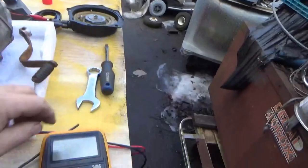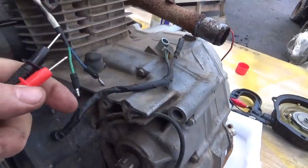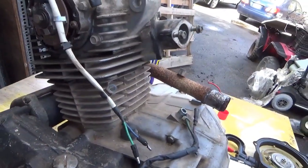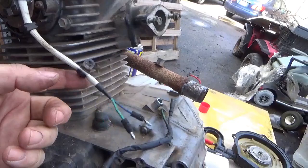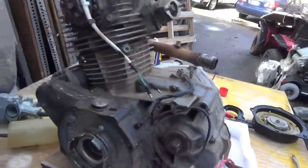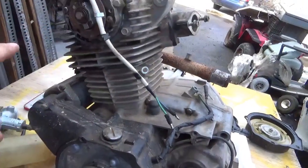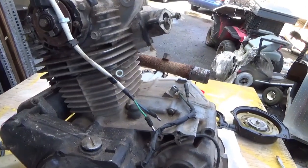One other thing to test: get your meter out and do a quick check of the pulse generator. This one is out of a parts box that was floating around, and I made sure the resistance was about 35 to 40 ohms. The really good ones are 28 to 29 ohms, but 35 to 40 ohms works. There's nothing worse than trying to get an engine started with a dead pulse generator, or your timing 180 degrees out — all the mistakes that will just stop you dead.